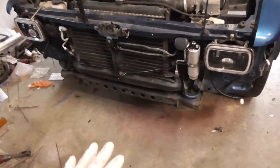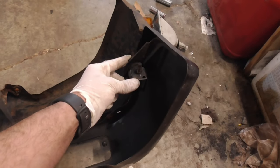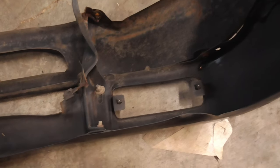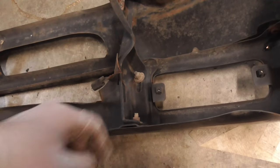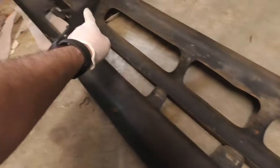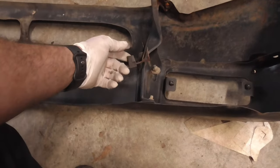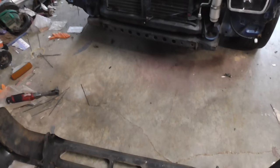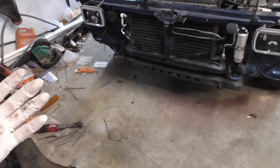It's not really something I want to mess with right now - it would be a lot easier on a frame machine, and this needs to get on a frame machine to fix the kink in the rear of the frame anyway. If you're taking this off and transferring everything over, you need to take these off each side, take the captive nuts for the turn signal, take the nuts off for the new brackets, take all the bolts from the bumper to the valence, and all the little plastic push nuts. You also have to take these rubber pieces off.